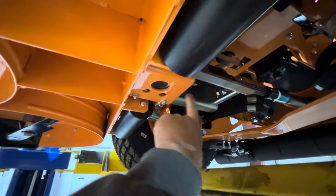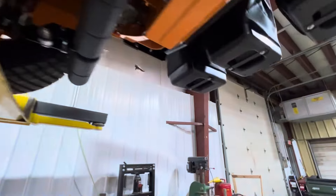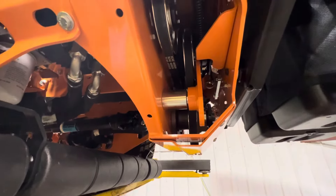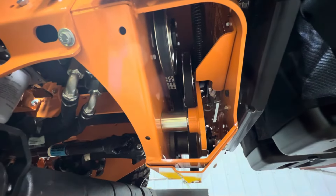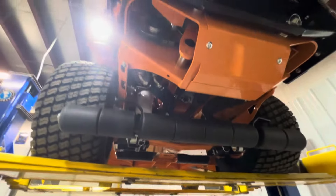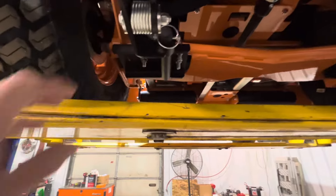Now that it's up, you can see the shaft here for the shaft-driven deck. There's a gearbox right up in here that runs your mower deck. There are belts still on this — they're underneath up in here. One runs your hydro pumps, one runs the shaft.